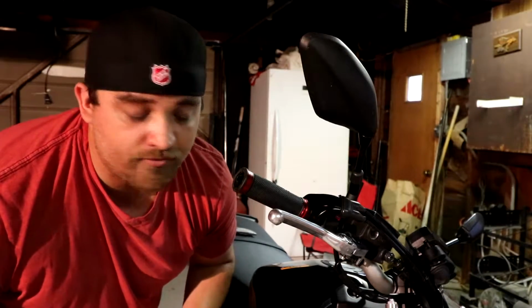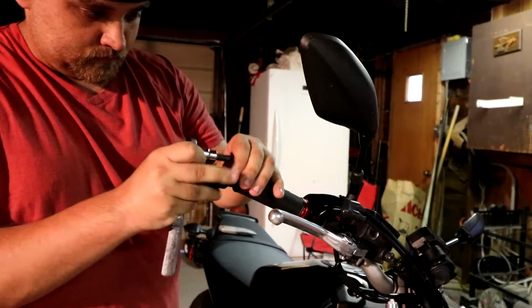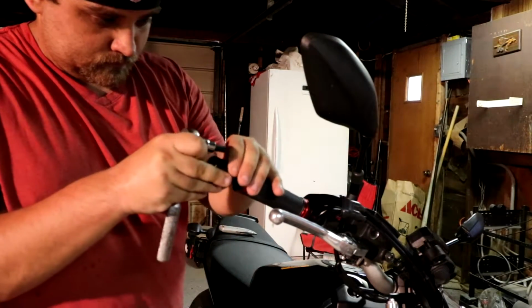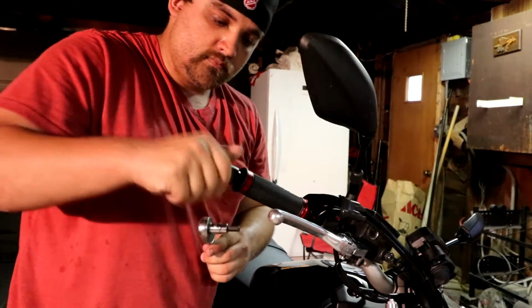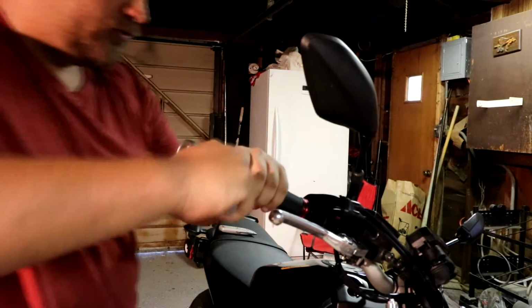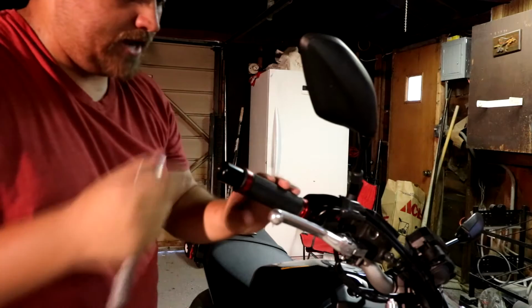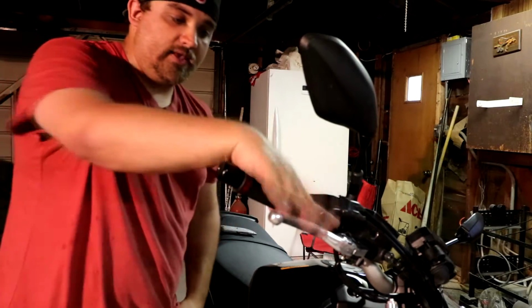Okay, so once you got your grip on, I probably hacked this video up to death and put a bunch of cutscenes, but the throttle side is the pain in the ass side, so that's why I tackled it first. After you get your grip on, go ahead and put your bar end back on. Start everything by hand and just torque it down. I'm not going to give you a torque spec. I don't use torque specs. You probably should. But yeah, that is the right hand side.